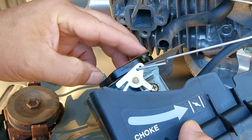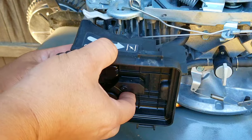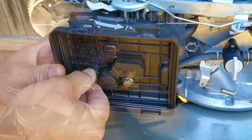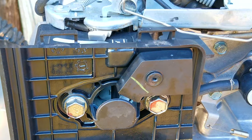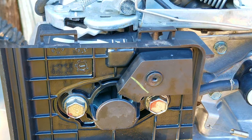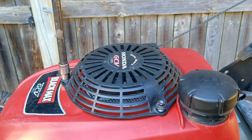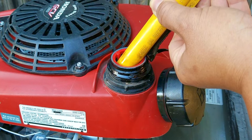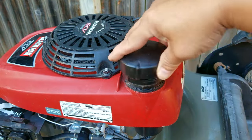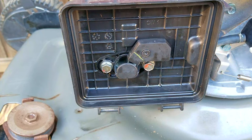As you can see, having to organize all the gaskets, carb, and insulator on the studs is a real pain, especially if you're doing this for the first time. My only advice is to take it slow and be very careful, as it's very easy to get one of these parts out of place. The last hurdle is to make sure that the metal arm for the choke delay is in the correct location for the choke lever. In fact, there are so many opportunities to make mistakes when putting this carb back on that getting it right the first time is kind of rare. After getting the carb and the airbox back on the engine, it's imperative that you test out if the choke system is working correctly. Any time you mess with the carb like we did with this one, after adding fuel to the tank and opening the fuel valve, you're going to need to wait — after taking the carb apart, sometimes when reassembling it there could be a problem which could cause a leak, and the last thing you want is a carb leaking gasoline, so wait and watch for any leaks to show up.